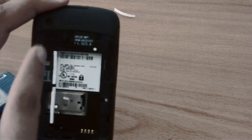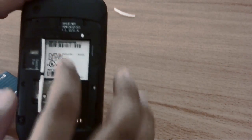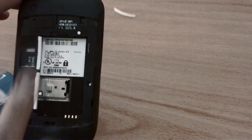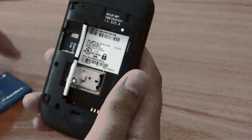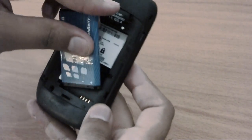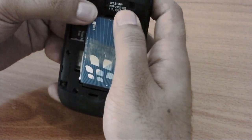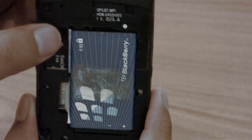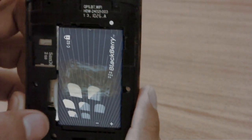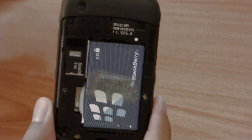You can also place the tapes like this. Because they are a little bit thick, we are having a little problem sticking it to this side and then having the battery go in. So we are going to install them like this. The first thing you want to do is get the bottom of the battery inside because there are little hooks there, and then you can basically force it down a little bit. As you can see, there is some double tape padding on this side, and this is going to make it so tight that the battery is not going to move around anymore.